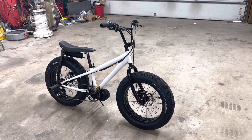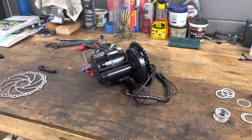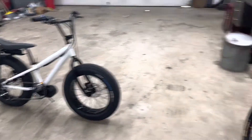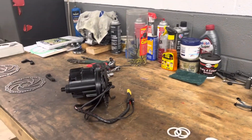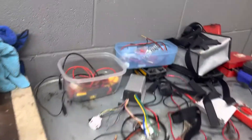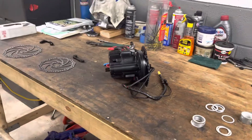This BBS-HD is made for a 100 millimeter bottom bracket, so if you bought a Mongoose King Kong from Walmart, I'll be able to use shims to pretty much restore the bottom bracket to 100 millimeters and the HD should just fit right on. The BBS-02 puts out about 1,250 watts; the HD puts out 1,500. The key difference is the HD is way more robust, and if we need more power we may upgrade to a Kelly controller which can give it 50 amps.